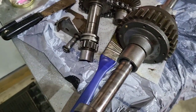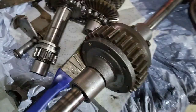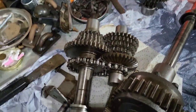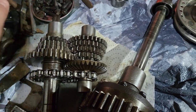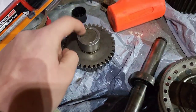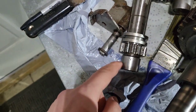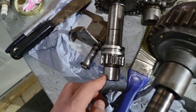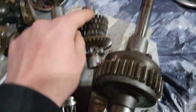Here's Crusher's 820 — this is just the five-speed. A tip for you guys: whenever I tear these apart, before I go to put these back together, I take off all of these ends and I pack them as much as I can full of grease. There are O-rings here so it's kind of sealed off, but I figured packing the needle bearings full of grease will definitely extend their life.